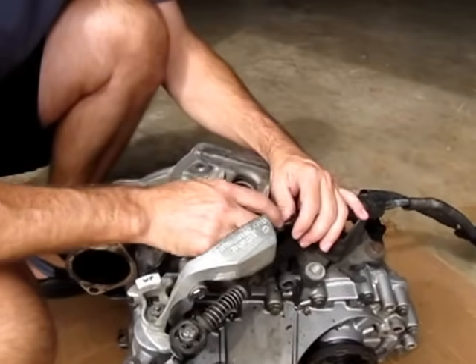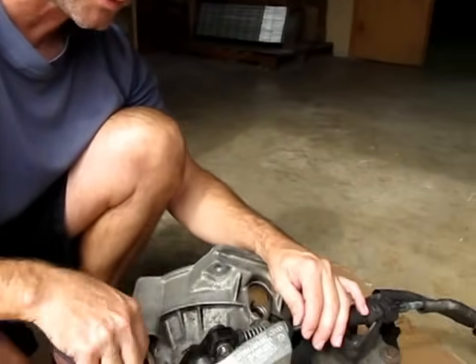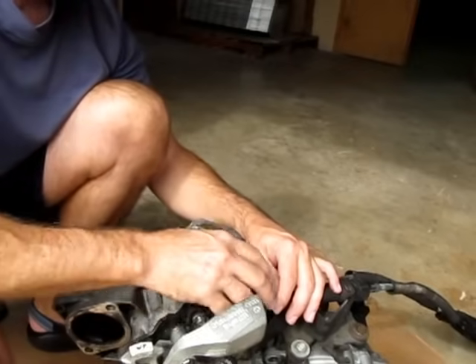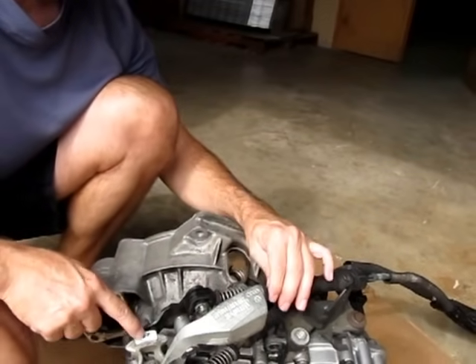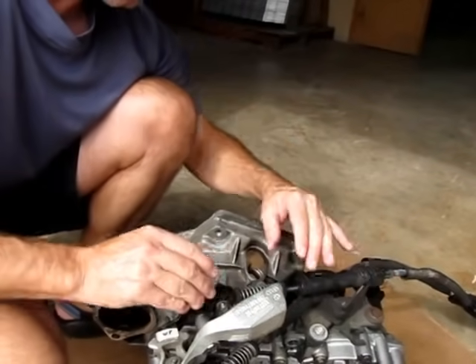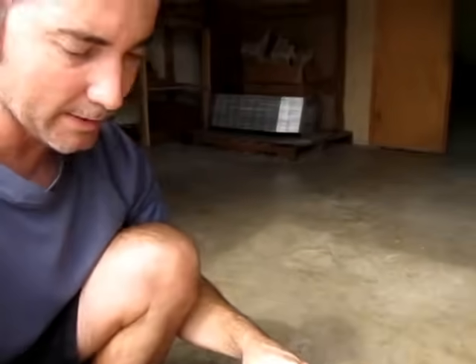It's critical that you take the slack out of the cable before you release the cable ends, because you're compressing all the slack in the cable toward the shifter and also taking up all the loose tolerance on the other side. There's a lot of slop in the system on a stock shifter that you want to pull out so your adjustment is correct. Once you've done that, you've gotten it — and that's pretty much it.